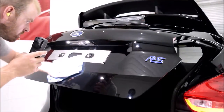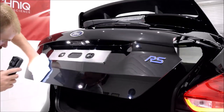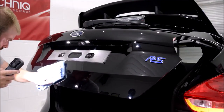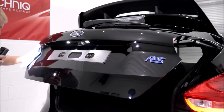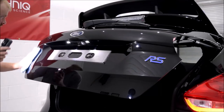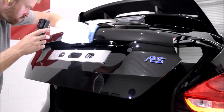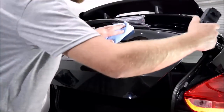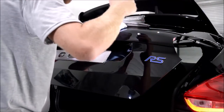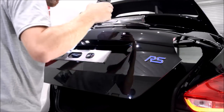Each layer of XO V4 takes me between 3 to 4 hours to apply and requires the same 3 hour wait time before applying the second layer. That's 3 layers in total at around 3 to 4 hours each depending on vehicle size — a multi-layer ceramic coating is not for the impatient. If you attempt this 3-layer, 5-year ceramic coating option, which I can only recommend for the serious detailing enthusiast or professional, you'll ideally need somewhere undercover to work, or even better, a controlled environment studio.